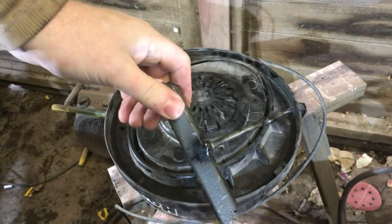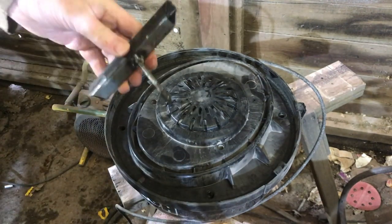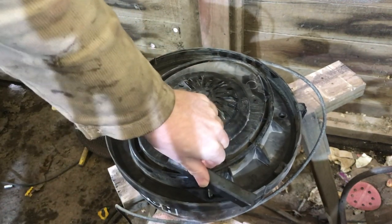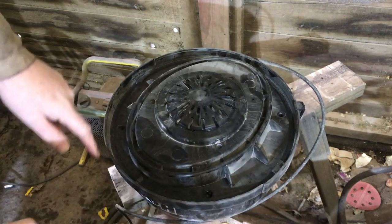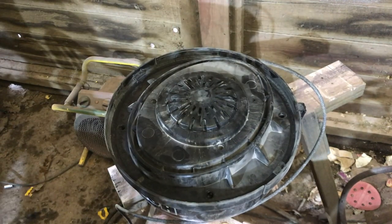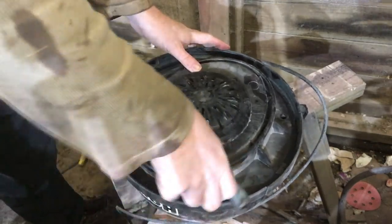First thing to do is look at Henry. I had a couple of quick looks at some videos to see how to take it apart. We'll take it apart and see if it's just switches. I made up a tool out of an old cheap allen key type thing to get down there, a nice little T-bar. The four big bolts on the outside - don't undo the three middle ones that hold the motor in - just those outer ones.